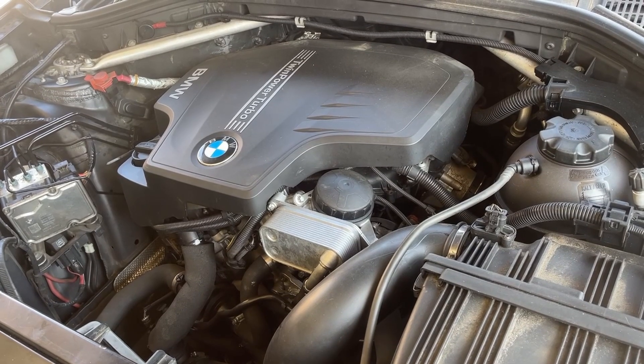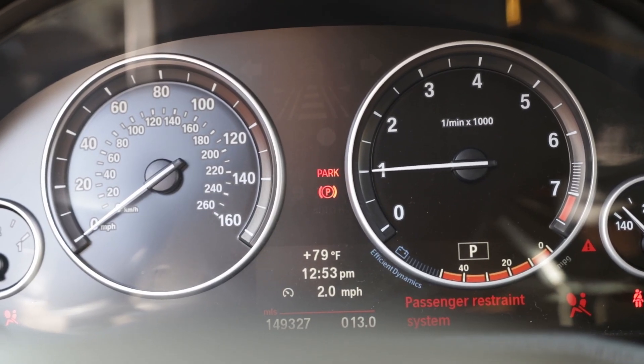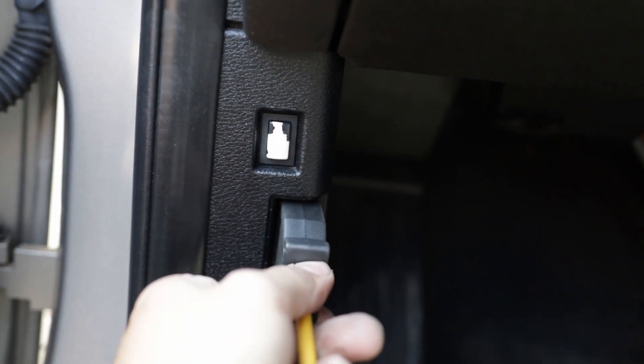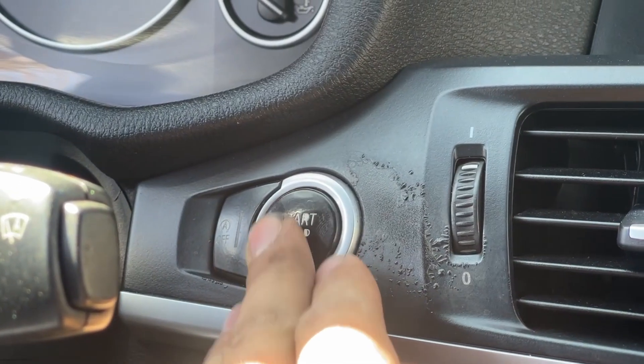So here's how my car runs — it's really rough, as you can see the idle moves up and down. It has some misfires and it's giving me some valvetronic issues. We're going to start off by plugging in the OBD2 connector on the driver's side, then plugging the other side into your computer. Before you start the software you want to have your engine running.